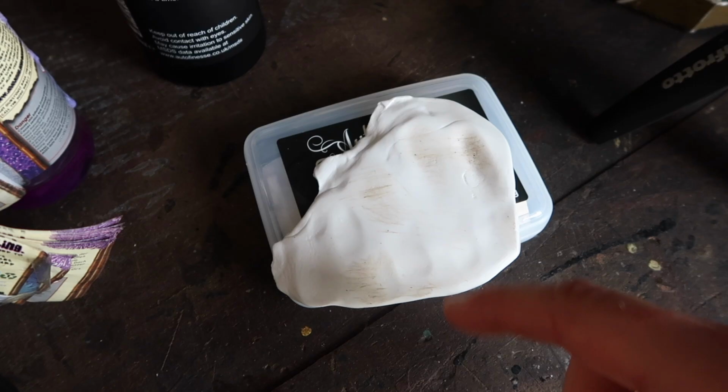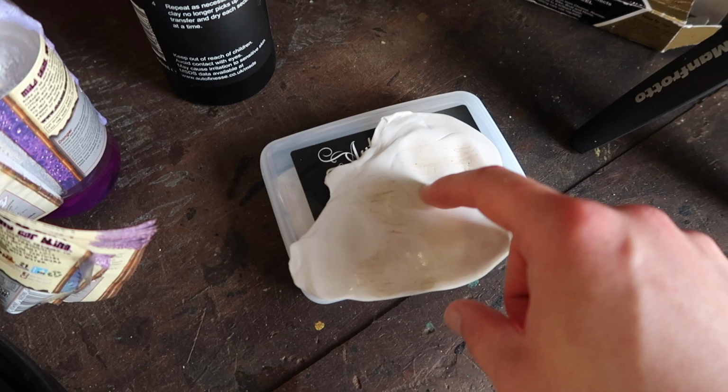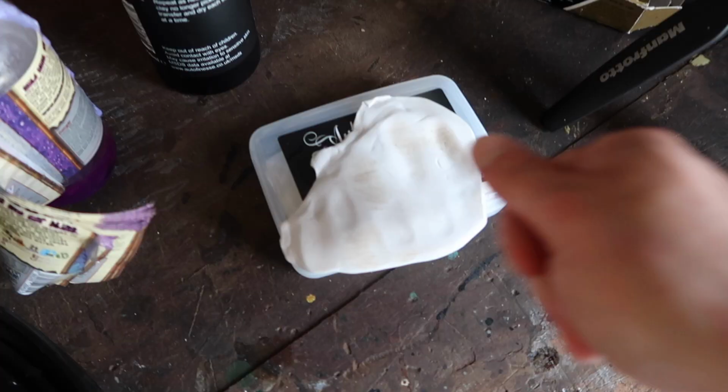Yeah, it just feels totally nice and smooth. That last section I did made the clay bar quite dirty, so now it's time to fold it over a couple of times and knead it back into shape, and then we get a nice fresh surface. Okay, so I'm still doing this bit right here, but man, I just had to show you how smooth the paintwork is coming out with the clay bar. Visually you can see it. Hopefully it's coming through in the camera, but it's unbelievable, it's so cool.